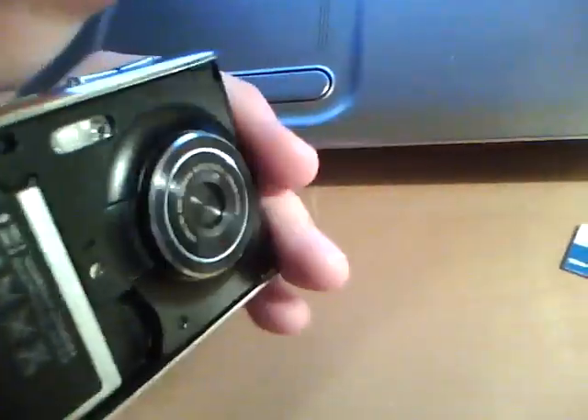And then pound, and then the phone. It said network deactivation, or like the lock deactivated. So now all we have to do is take out the battery and put the AT&T SIM in, and then put the battery back on, power it up, and it should work.